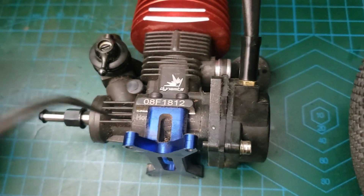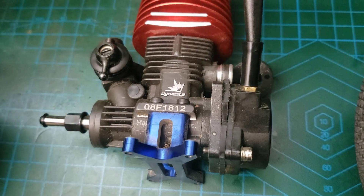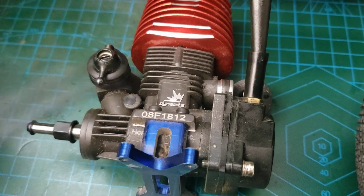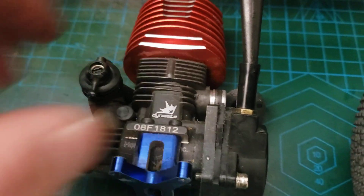And then if you get one with two dots, that one's completely fixed and the Traxxas pull starter will have no problem bolting on. But like I said, the starter shaft and bushing combo just keeps chewing up on mine, so I've given up on that for now.